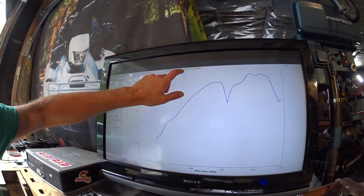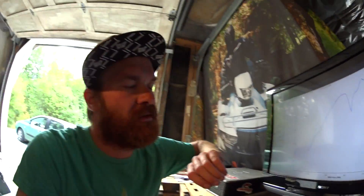Anyway, with the new needle we are clocking in 17 horsepower at the wheel. That's almost two horsepower over the best on gasoline. This is just from one run so there might be some slight variations, but I think it's safe to start playing with the ignition. I'm going to increase the advance by two degrees around peak and see what happens.